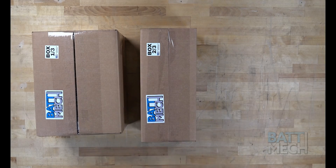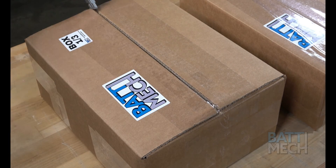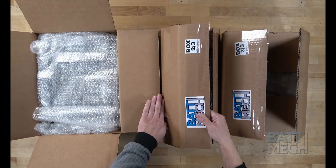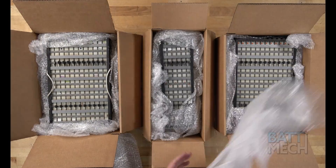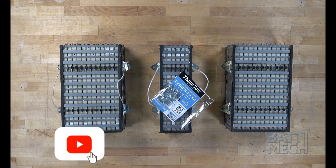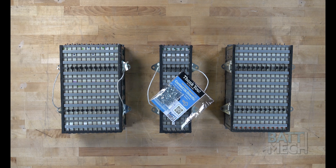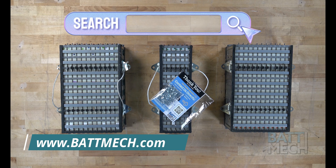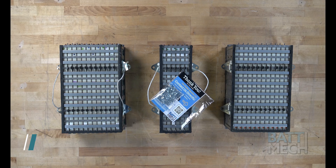Now that the battery is completely disassembled, you can prepare to reassemble the battery. Carefully unpack your BATMEK boxes. Your BATMEK batteries are individually tested to assess leaks, capacity, voltage, and internal resistance. The highest and lowest capacities are arranged to optimize the pack's performance and to optimize the differences in block voltage throughout the pack. Each pack is load tested at the same time, but BATMEK monitors the voltage of each individual module when testing. Packs are tested under a high current load.